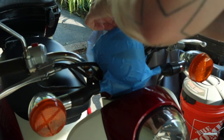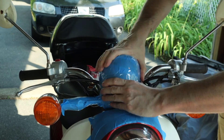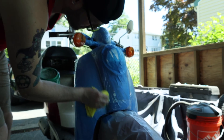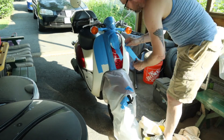I'm going to be using fiberglass, and what I'm doing to prep the scooter itself is putting painter's tape over all the pieces I wish to make a mold of. I put painter's tape down, then packing tape, and then add a layer of wax. This just helps release the fiberglass from the tape itself. If you just put it right on the tape, it usually sticks really well. Having the painter's tape and the packing tape there helps a lot better when you go to pull it off.